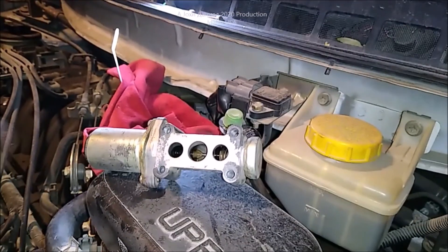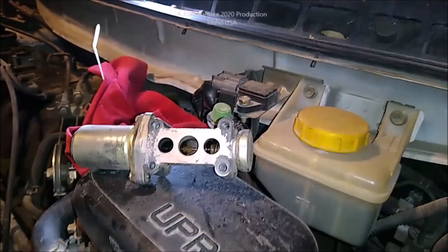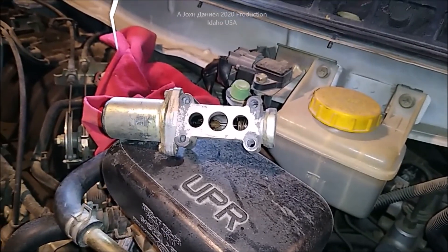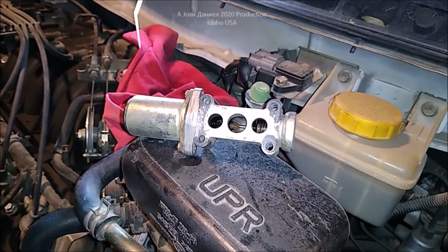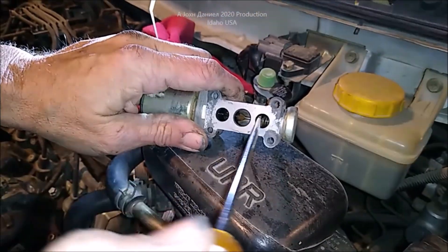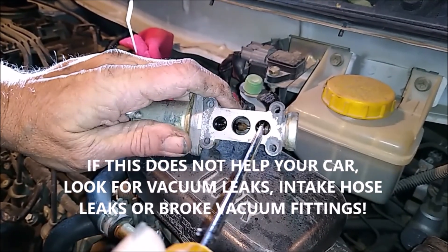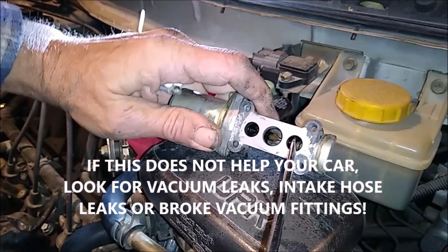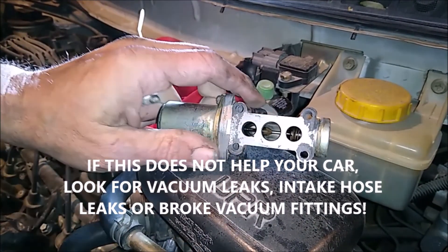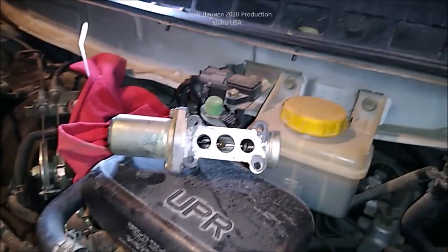You can also take a small screwdriver and work the valve back and forth — don't push too hard against the motor so you don't strip it. Get it completely cleaned up to where it'll move freely. You see that movement? You see that second one right there — you see all the carbon on it. We've got to open that up, spray it, and then this will work again and it'll idle without dying at a stop sign.